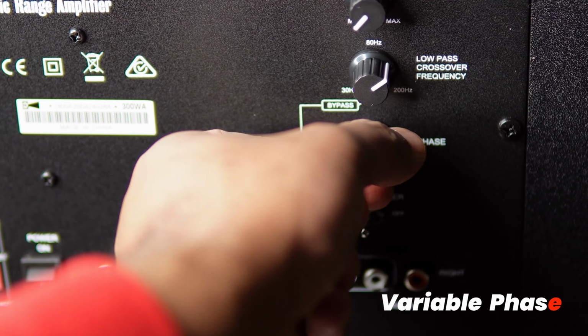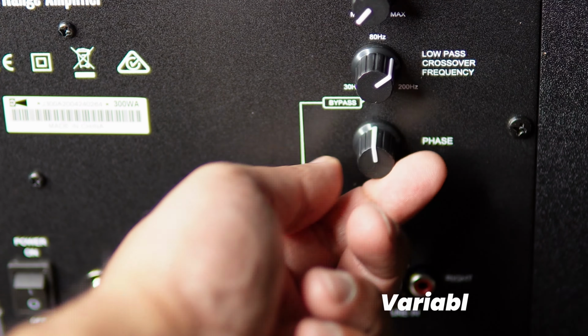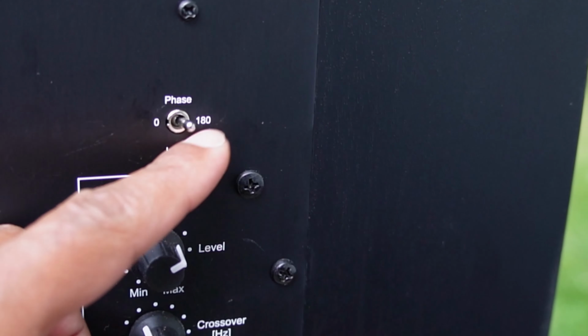The variable phase knob, I have to talk about that first, because most subwoofers that you can spend this much money on just give you a flip switch that goes from 0 to 180. This one, if you are able to measure the subwoofer with a calibration microphone, you can align the phase perfectly to match your entire system. I've done measurement videos on my channel, so if you're interested in that, I'll leave a link to that video in the description. And the third thing to note is the auto on-off switch.